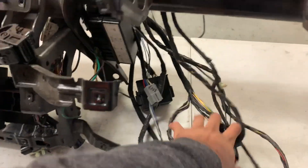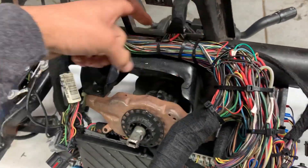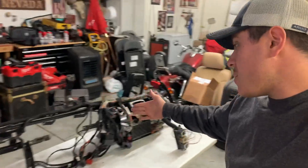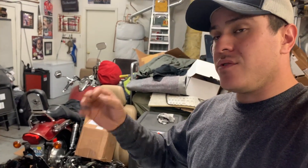That's pretty much all done. I'm going to go ahead and unbolt this, box it back up, and ship it back to the guy. When I pull it off I'll be able to tape it up more - I can't get the tape behind there right now. I like making little tips and tricks and showing projects. If you build your own harness, this is basically what mine look like - I start from the passenger side and work my way to the driver's side, starts easier and gets more difficult. It's really not that hard if you just go wire by wire, though there's hundreds of them.